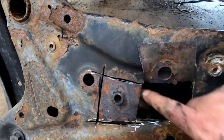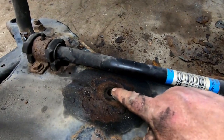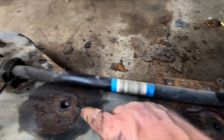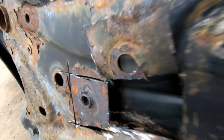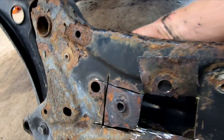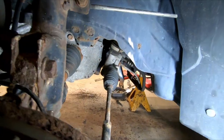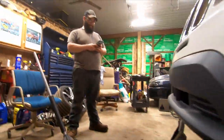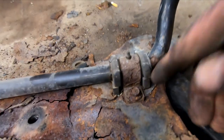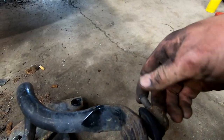That's it — 2011 Compass, and that thing rotted right through and broke while the lady was driving. So this is what I was talking about: I cut this door in it so I could heat it, because this is where your rack bolts up and those two would not come loose. The only way I could do it was to cut these windows and heat it inside with the oxyacetylene — get it cherry red — and then turn them out. We left the axles in, the whole nine yards.